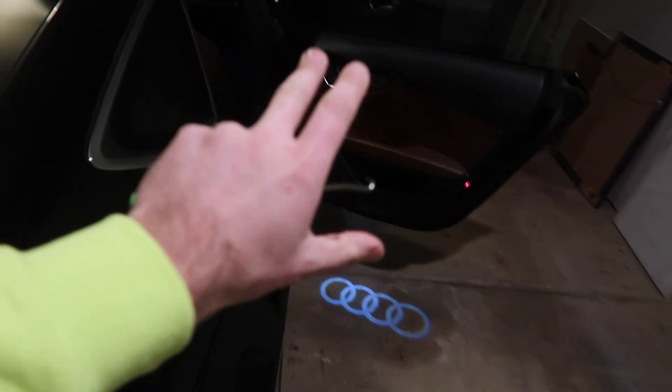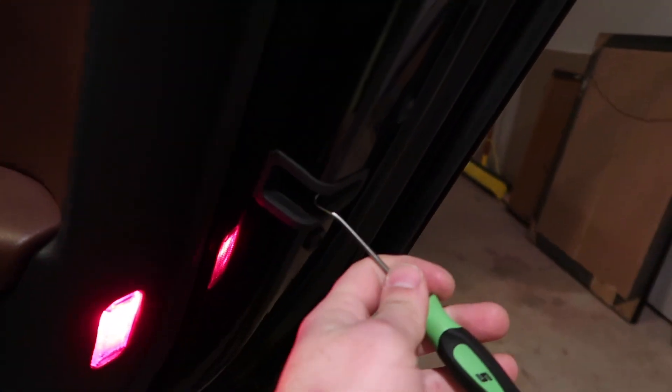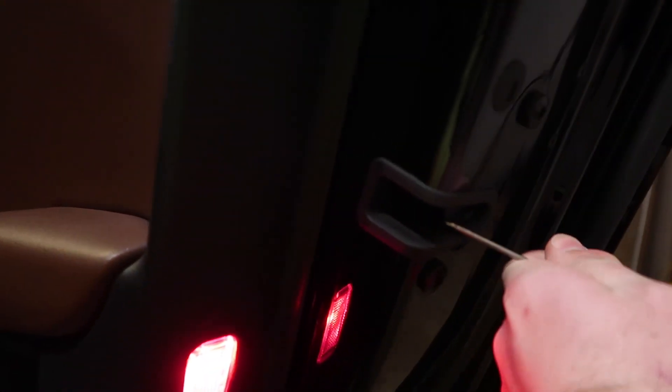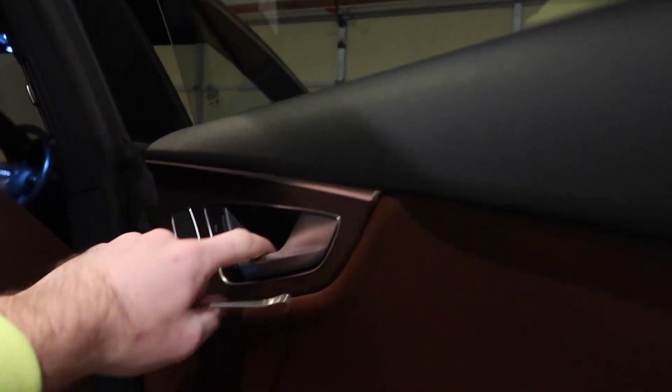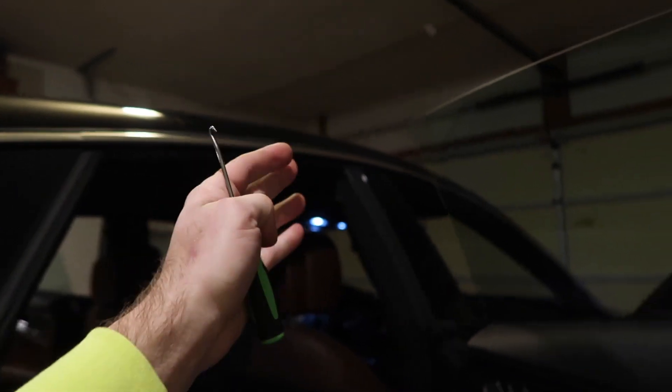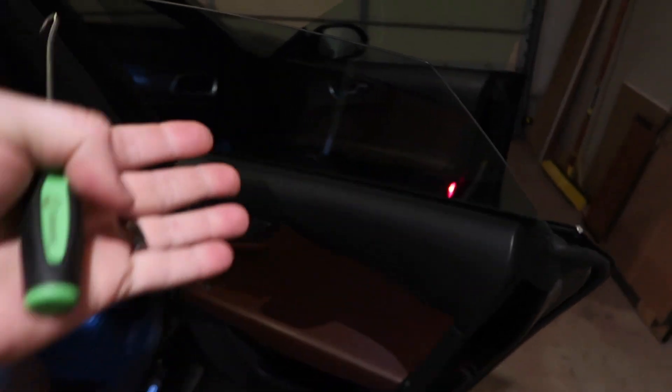Basically I'm going to start by opening all the doors. With these frameless windows, because they drop a little bit when you open the door so the glass doesn't break, there's a little industry secret — you take a pick tool and there's a latch. When you push the latch in, the window actually goes back up to its original spot. We call this tricking the window. Make sure you do not forget to pull the door handle before you shut the door, otherwise that glass edge will catch on the metal. That way you can see more of the window when you're ready to lay the tint in.